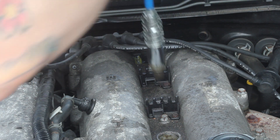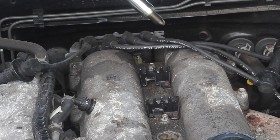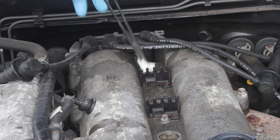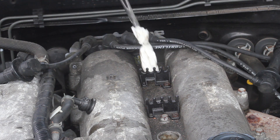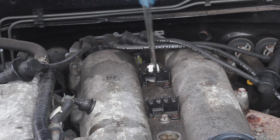Now on three and four I noticed I'm getting some oil dripping. That hints to me that the rocker cover needs to come off and the seals need to be redone as well. I'm just going to use some forceps and some kitchen tissue to clean up the plug wells, since when the plugs came out some oil probably dropped into the cylinders — there will be a little bit of smoke when it starts, but I just want to clean up what I can.